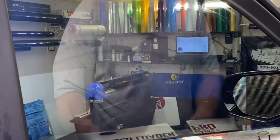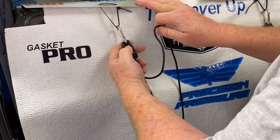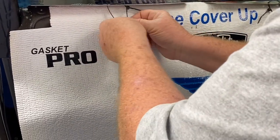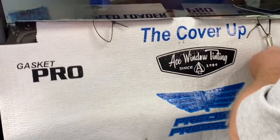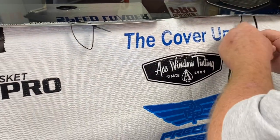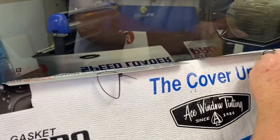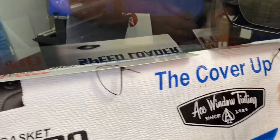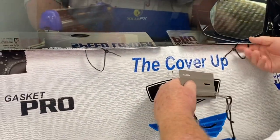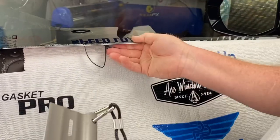That's how you do these windows. On this right here we just put a little tension on this and release the tension. We've run out of handles, so I just opted to use them this way for myself — it worked out pretty good. The handles should be in today so we can get some back on the site. This little clamp goes up out of the door; it's made out of polymer and doesn't scratch anything. These two go right here in the film and you slide them right straight up and out — it holds the panel cover.